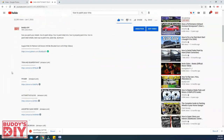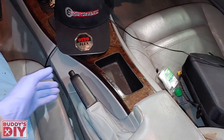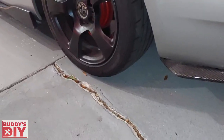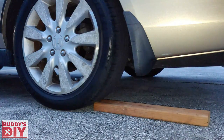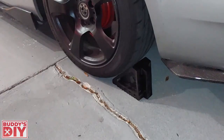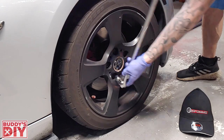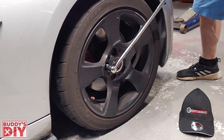As always, under the video in the description box I'll have Amazon links to all the tools and materials I use for this job. Before even jacking up the car, the very first thing you want to do is pull up the emergency brake. Then we're going to apply wheel chocks to the back wheels. If you don't have actual wheel chocks, you can use a 2x4 — just be sure to wedge it in the back wheel nice and tight so the car doesn't move. Now with our emergency brake up and wheel chocks in place, we're going to crack the lug nuts loose while the wheel is still on the ground.